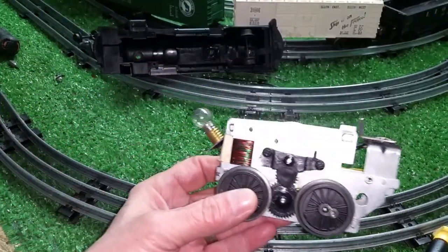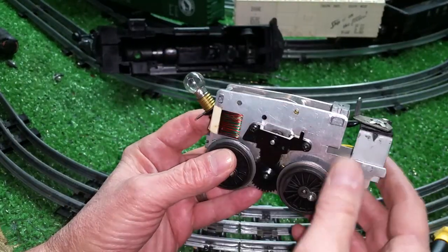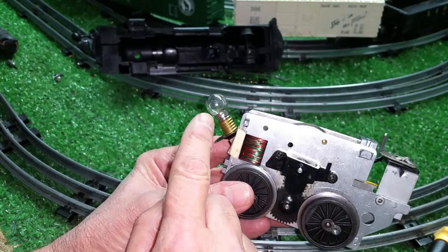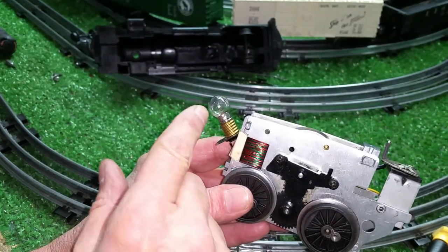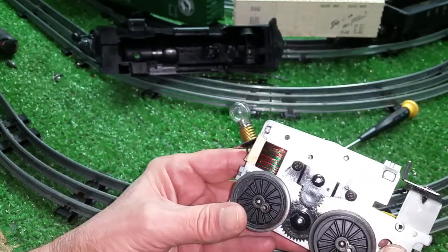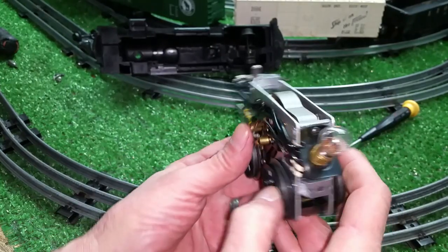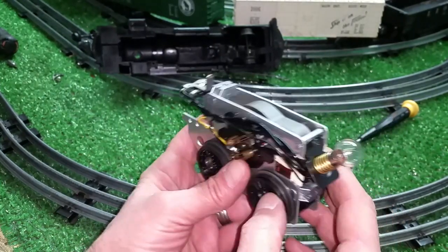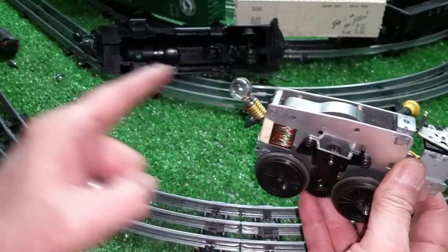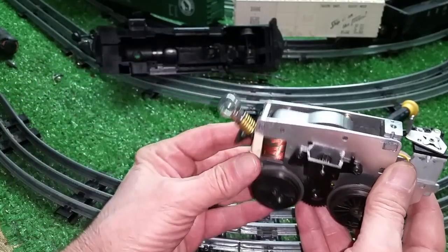So while this is out, you can see how I've mounted this headlight. I originally had it on top facing forward, but it's too close to the plastic that way. The drawback to these E10 bulbs is they get hot — if this thing is on for three minutes and you touch it, it'll sizzle your finger. They get intensely hot. So as you see, it was pretty simple to mount this. I've just put it on a bracket and then bent the bracket up so it's in line with the lens, but it has more than enough space above it to dissipate the heat. It works rather well.